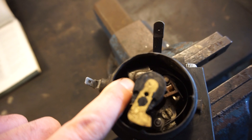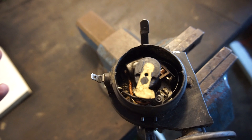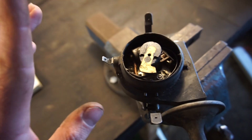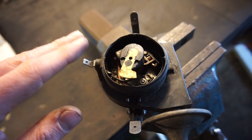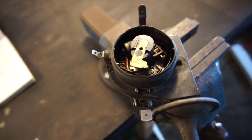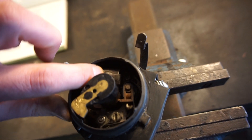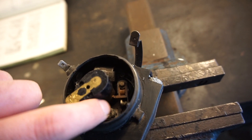The condensers are a common failure point. I've heard a lot of people talk about newer condensers that are not made as well as the old ones and fail pretty easily. I have not experienced that myself - I run cars with points ignition, I put in new points and condensers and I've never had a failure. But some people say they have a lot of failures. A lot of people say that the old condensers, the high quality ones from the 60s, will last forever. So some people keep them in there and just replace the points.